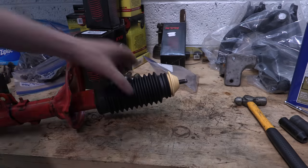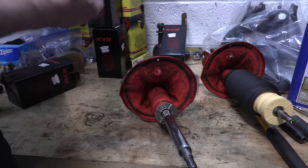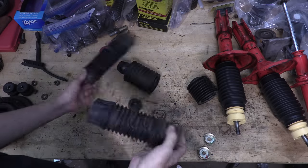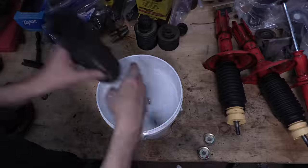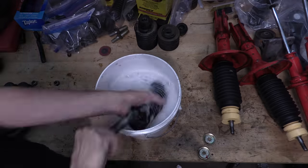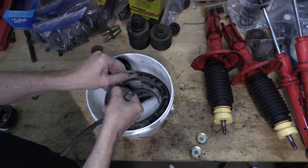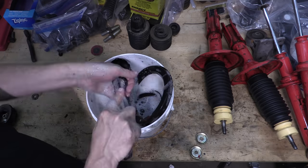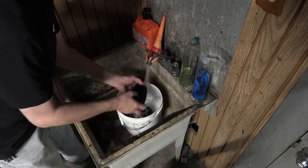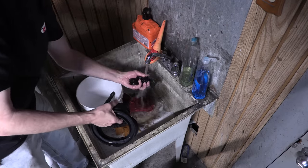These boots were definitely the right ones for the front once I figured out how they're supposed to be oriented, and they're going to be a great fix. But these don't work at all on the rear struts — always look at the thing first. Because I didn't, I'm just going to reuse my original boots because I couldn't find a KYB part number to replace these units with, and the other generic stuff doesn't work anything like what my struts actually need. The top of the boot perch is a big thick integrated washer that has a small hole to fit the strut shaft and transfer all the damping forces between the wheels and the strut perch — that washer is what does it all.